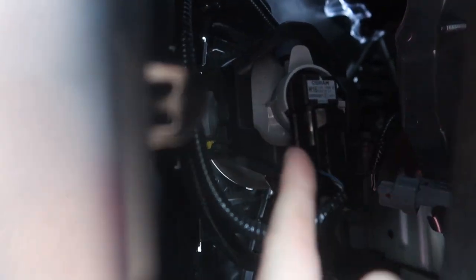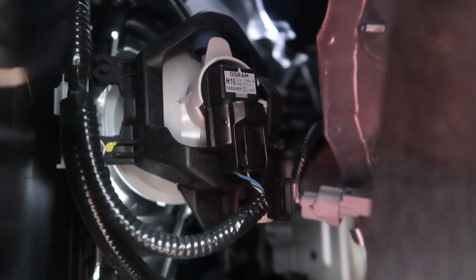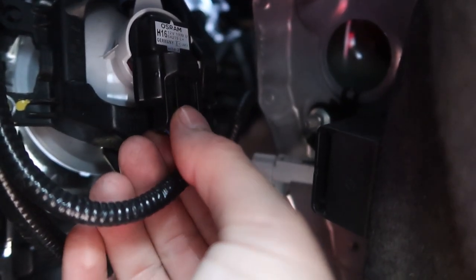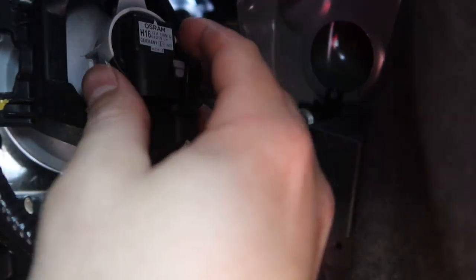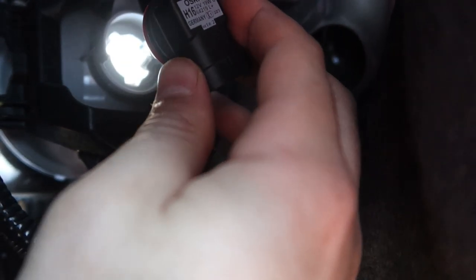Once the clip is out, you can pull back the tab and pull back the fabric — it's just a fabric insert. Get your hand in and pull this fabric out. That'll allow us to access the bulb right there. So that's the bulb we need to take out. The first thing we're going to do is remove the harness from the bottom — there's a little tab you push to pull the harness off the light. That'll allow us to turn the light to the right to pull it out. You have to remove the harness first because it'll get blocked when turning.